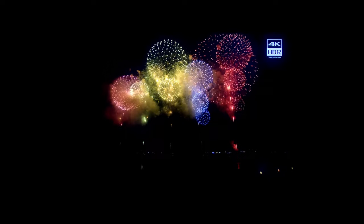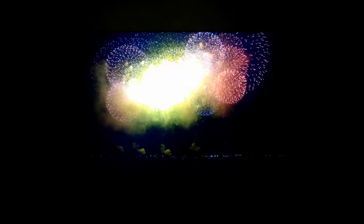It looks amazing. And what makes it look even better when you're watching 4K HDR content and real world content like movies and other YouTube applications or Amazon Prime, Netflix, is you have this improved local dimming setup and algorithm with more dimming zones. Right now Samsung uses the mini LED backlighting system, and you combine that with 2,500 nits of peak brightness, and that's when you get insane HDR impact.